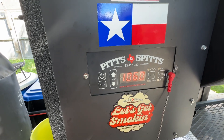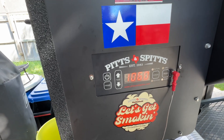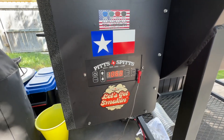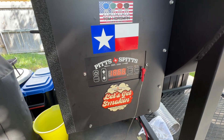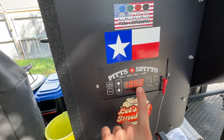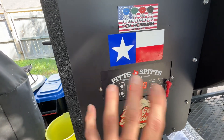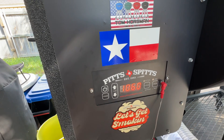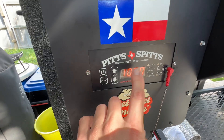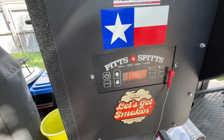You can fiddle with this up and down — put your probes in there, monitor temperatures, and give it about 30 minutes to adjust to changes because they don't happen right away. You will have to use some pellets doing this testing. 1040 seems to work well for a nine-hole fire pot, and 1060 for the standard fire pot with U1.16 firmware. The logic is that the C13 value changes what the controller thinks the temperature is from the RTD probe — that's why they call it RTD gain.